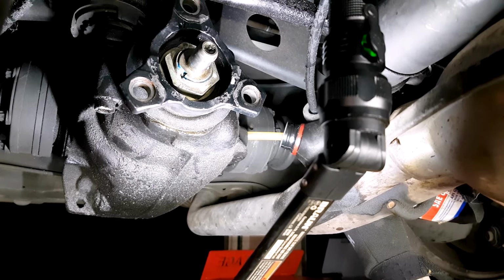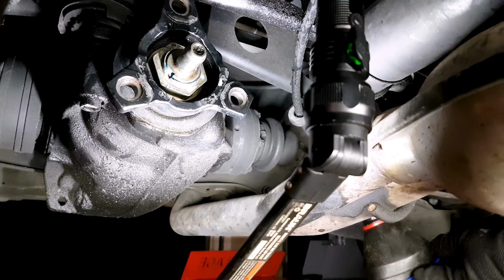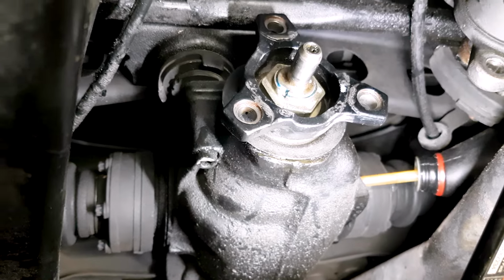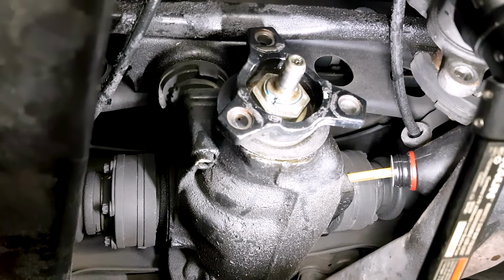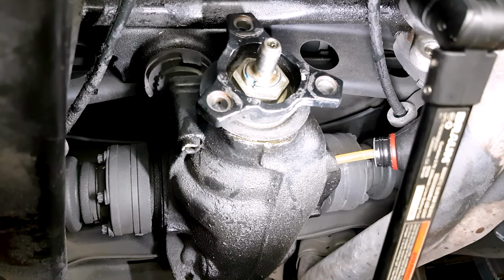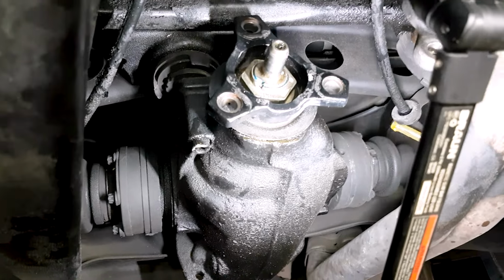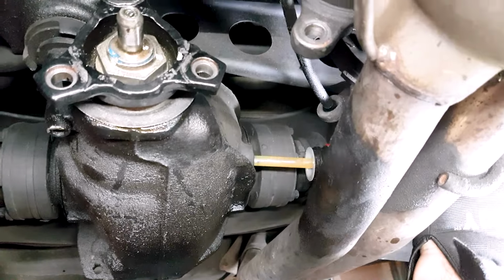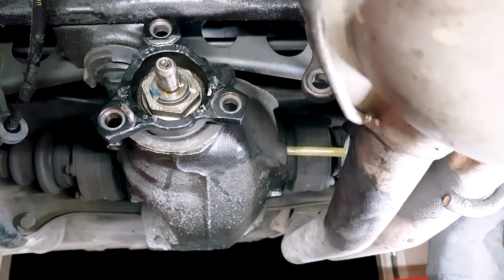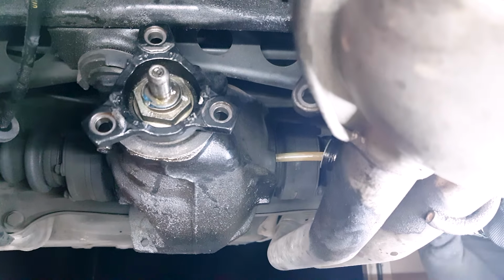And then pump again. And you'll have to do that a couple of times. So this is better than draining the fluid all the way out, where you would lose a lot more fluid. Now, if you haven't replaced your differential fluid for 30,000-40,000 miles, then that's probably what you need to do. Start with draining it first and then at the end fill it back in. But I had replaced the fluid recently on this car. Therefore, I'm just replacing about a quarter of a liter, or what came out during the seal replacement.